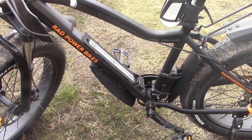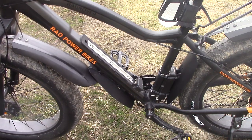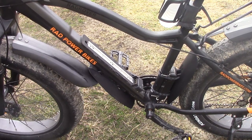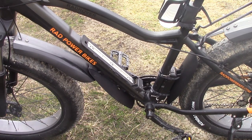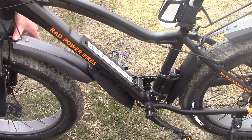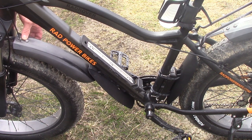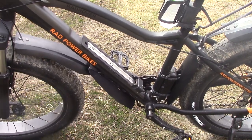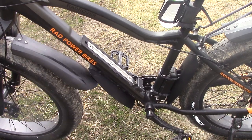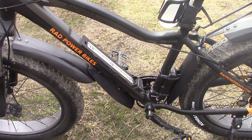The only thing that came out for mine was a little drag — once in a while, depending on how the bike's sitting. What I'm going to do is bend the frame mount, or drop the mount of the front fender down a quarter inch, just to make sure that it doesn't hit the mud guard on the tube. It doesn't hit all the time, but it does once in a while. So I think I'm going to drop it a quarter of an inch. That's all the mod I've had to do.